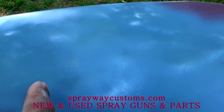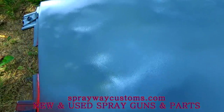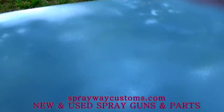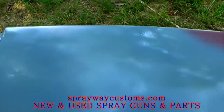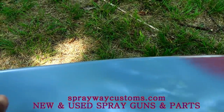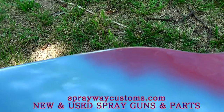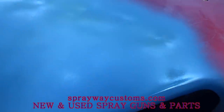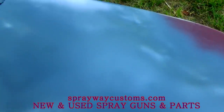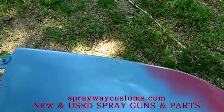You can see a little line right here. Let me see, can I get you? See it, see that there? That'll be all right, because once I wet sand it, I should be able to get them lines out. There's another one up in here, but I can wet sand that out. Everything else should be good to go. Even if I can't wet sand, I could put some little glaze in it. That'll take care of that.